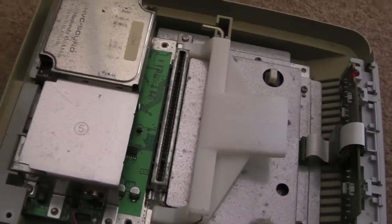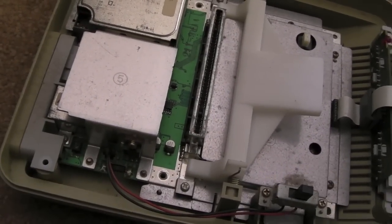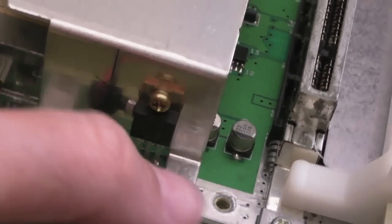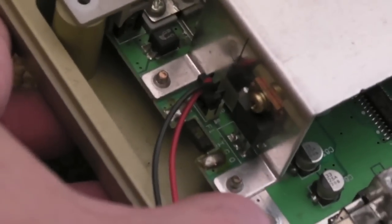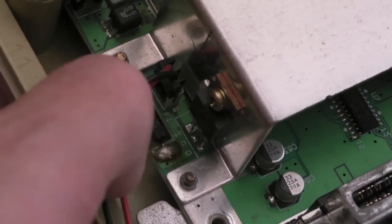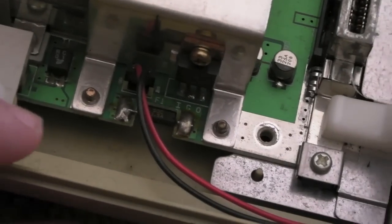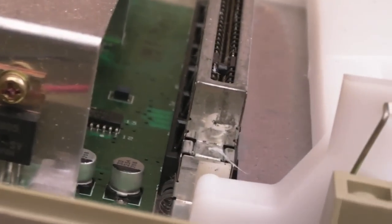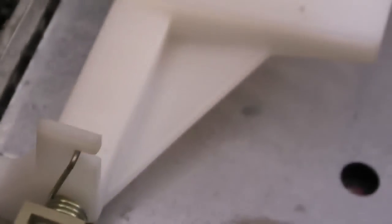Something I've just spotted — you can see there's a fuse. Let me zoom in so you can get a closer look. Just move that wire out of the way. That black ceramic-type package is held just by the solder points — it's floating over a gap on the board for safety reasons. There's also a voltage regulator — just a 7805. I didn't expect that; I thought different revisions might have different regulators, but it's just a standard 7805.